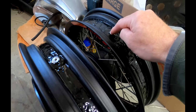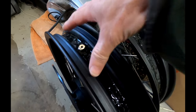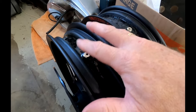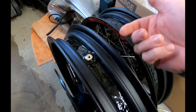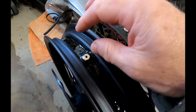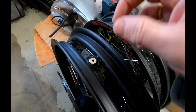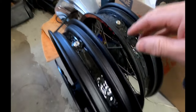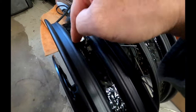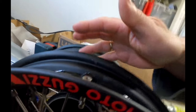I've installed the new valve stems all the way through — I did have to drill out the hole very slightly to fit the new stem — and I added sealant all the way around so they become part of the seal. These stems usually only fail at the rubber washer backing or the Schrader valve inside. With rubber sealant all the way around, the washer won't fail, and if the Schrader valve goes I can just unscrew and replace it. They're essentially now part of the rim.